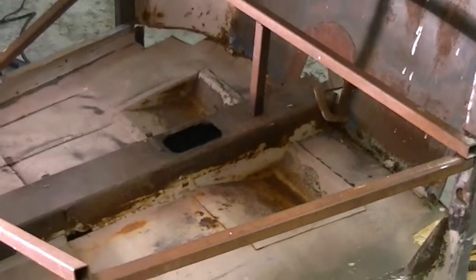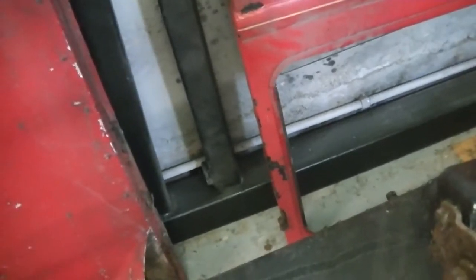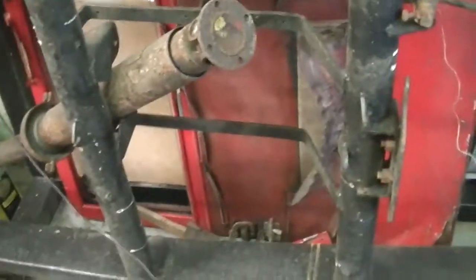Obviously I can't put the doors on. Normally most people chop the doors and the body all at the same time. I can't do that, one because there's steel in the way holding it together, two the doors need repairing before anything. But being as they're both straight and square, I should be able to just take 4 inches out of there. It should be alright hopefully. Like I said, I'm not using original hinges. Might try and use the original door latches, I don't know. And depending how it works out, I wouldn't mind putting suicide doors on it.